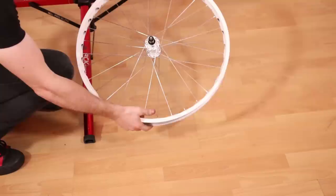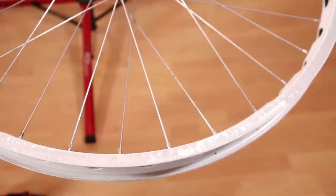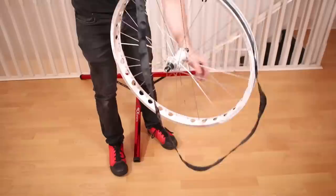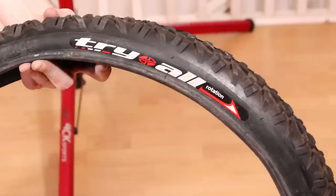Can't be bothered building it — let's do this the easy way. Paint is no good for the rim brake. I'd normally grind the rim after putting the tyre on but it's getting late and I don't want to annoy the neighbours so I'll do it now. If you're new to trials and don't know why this is done: it gives high friction in all weather. Using special harder pads the brake is a lot more powerful. The downside is the brakes become very noisy and rims wear out faster, but it's worth it for the extra power trials needs.